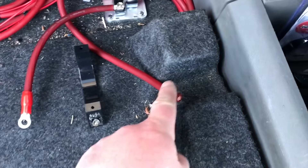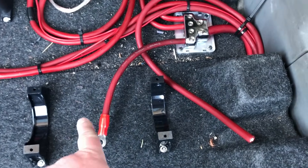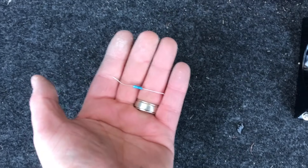At this point I'm going to go ahead and put a ring terminal on there, measure everything out and get our capacitor mounted. Now, before you throw on the positive and negative, the capacitor will have to be correctly charged. We'll be using this resistor supplied with it — read your instructions, it'll show you how to do it.